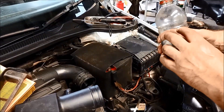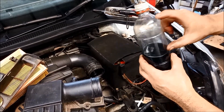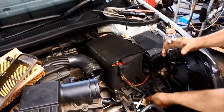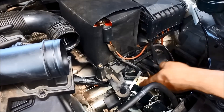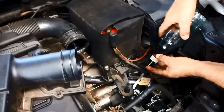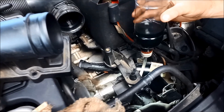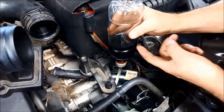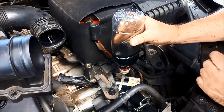This idea of filling it like this is a lot easier than with a syringe because you've got that volume of air to burp the airlock. We've got this plastic tube that will fit nice and snugly in that breather tube, and then I can just gently give it a squeeze and let it go. You'll see it burping back through the bottle — a lot quicker and easier than doing it with a syringe.